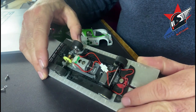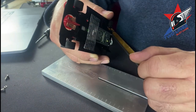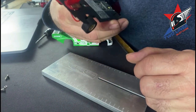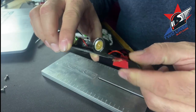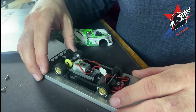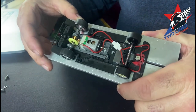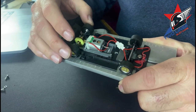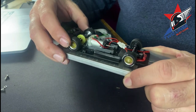I did change the guide out — this is a Slotting Plus guide, which gives just a little more confidence in the slot. I really like it. That's the original braid; I didn't change the braid out. I like the Slot-It braid — it lays really flat and it's pretty thin, so it's pretty easy to work with. So all in all I'm pretty happy, and honestly guys, that is really all of the tuning that I've done: a little bit of oil, some lithium grease on the gears, oil on all of the bushings.